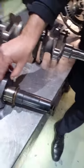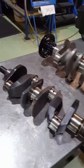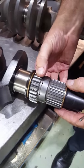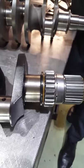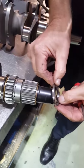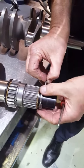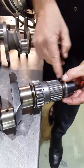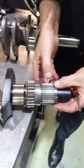So here's a conventional crank and here's a modified one that we cross drill, wedge, blade, back drill, grind and heat treat. There's your standard thrust washer which goes behind the primary gear. We'll slide the primary gear on - that's where that would normally sit. You then have this, which is the C-clip locating washer, which goes on there, and then the C-clip drops into the slot. All that assembly ends up with having end float for the primary gear, because obviously if the primary gear comes out this way or that way it needs to be held in position.